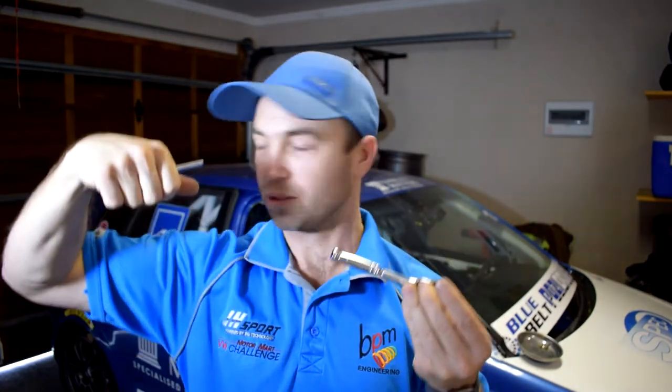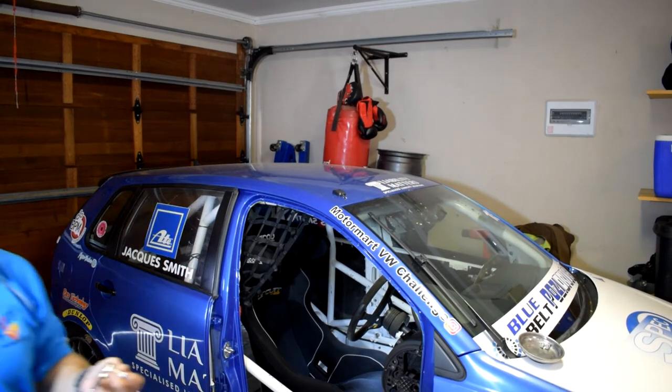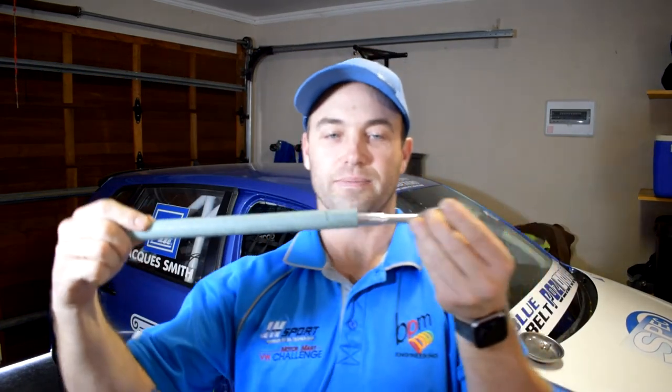I've seen a lot of guys on YouTube and whatever, they use this and then put a pipe on it to lengthen it. Like so. That's a bad idea, because you're going to end up shearing the teeth inside the ratchet. And that goes for any ratchet, the big ones, everything. It's really good practice to use this to take up the slack, and then use the T-bar to actually tighten it, or the torque wrench, whatever you're doing.